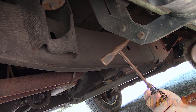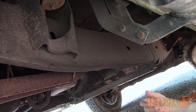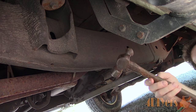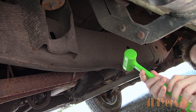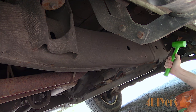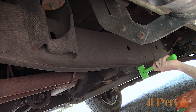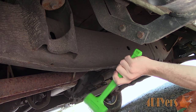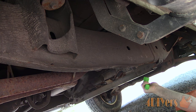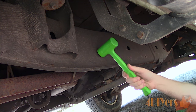A chipping hammer such as what I have here is excellent for poking at rust — with the pointed end you'll find a soft spot right away. Another option would be using a ball peen hammer. I'd only recommend using this on rusty areas where you may see scaling or bubbling. Don't use this on any painted areas as you can risk chipping away the paint and removing that layer of protection. As for other parts of the frame, use a dead blow hammer instead. For this I have my OEM Tools three-piece set, model number 25517. With the rubber exterior this helps prevent any damage to the paint, which would be hard to prevent with a metal hammer. A link to this will be included in the video description too.